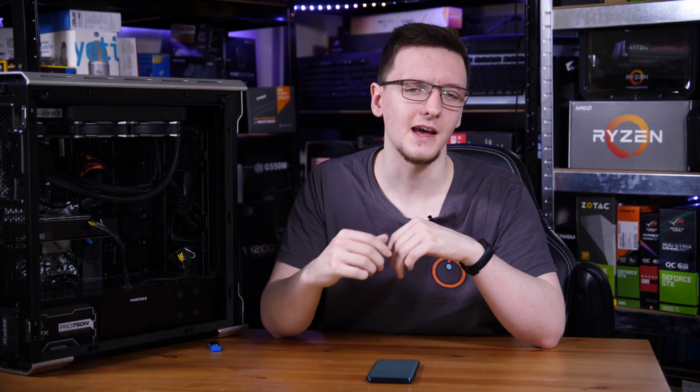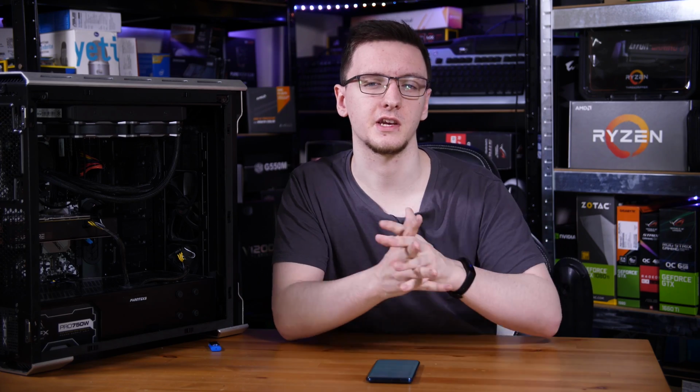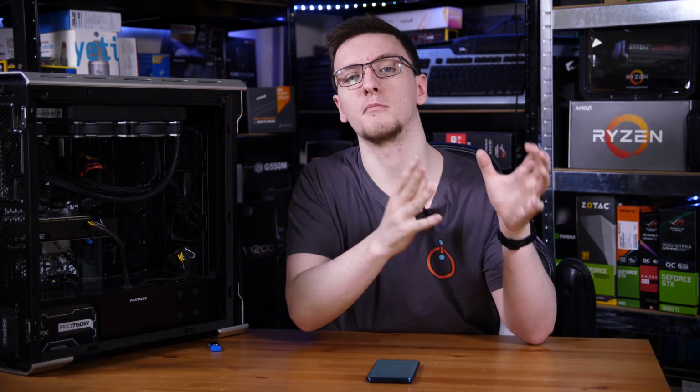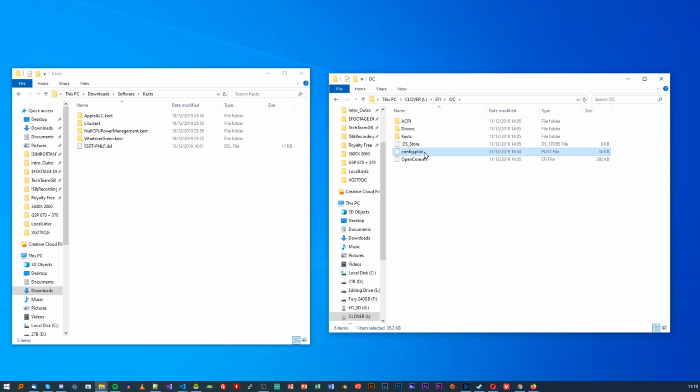But if you're using, say, that Realtek one, then you want the Realtek RTL8111H in there. If you're using Intel, then it depends which one. If you're using most of the older Intel chipsets, then the IntelMausi Ethernet kext is the one you want, but the newer 211 chipsets are handled by the SmallTree kext that is also already in there.